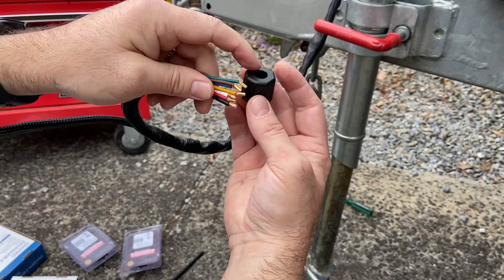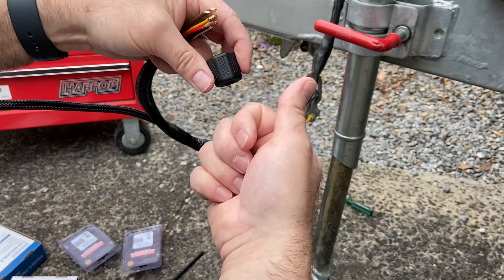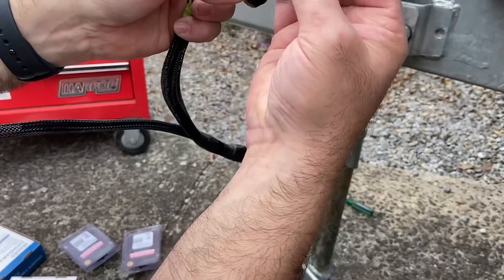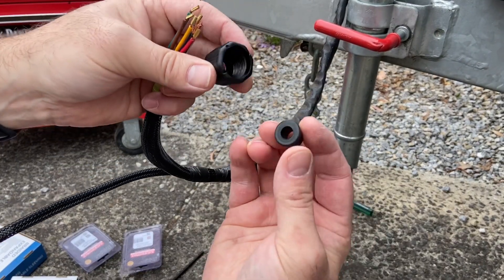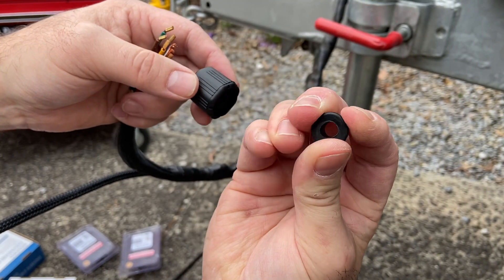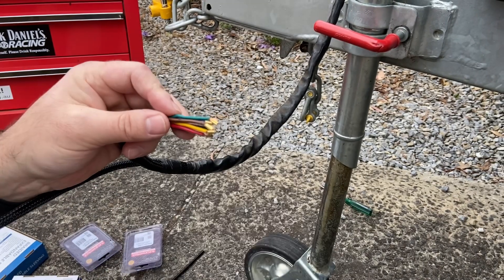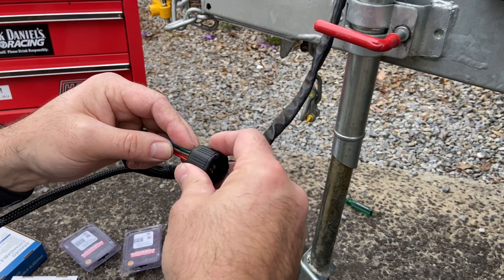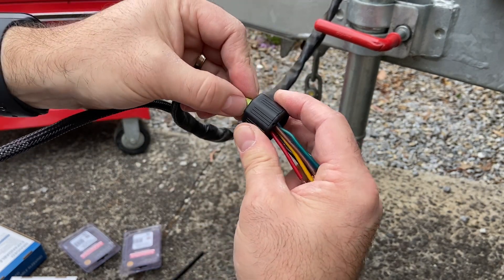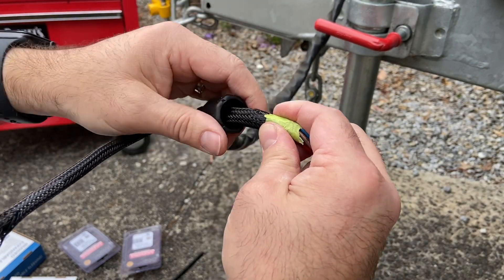Because it's a little bit thicker down here I've had to drill that out - when I say drill, just drill by hand and open it up slightly. There is a gland that goes over to give it some waterproofness and it locks it as well; as you tighten it up it squashes around the wires and makes it waterproof - well, that's the idea anyway. I've put a little bit of tape there just to stop the fraying of the braid. The braid is great but you can't put too much tape on otherwise you won't get it over.